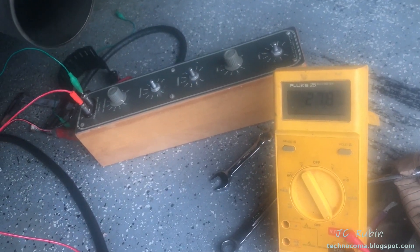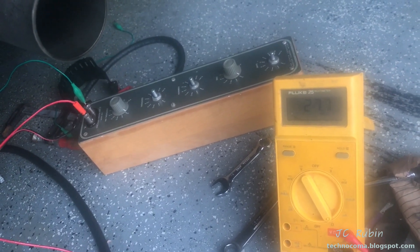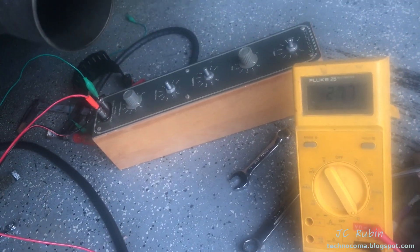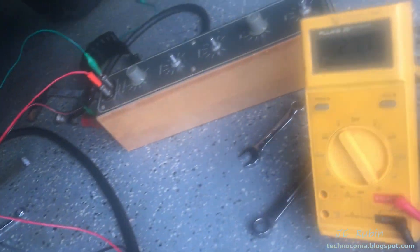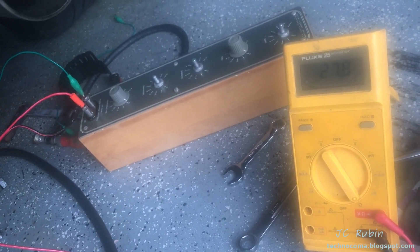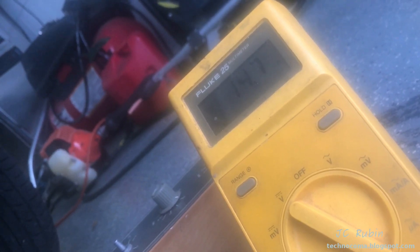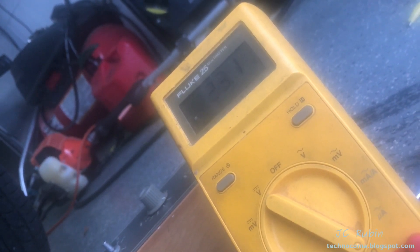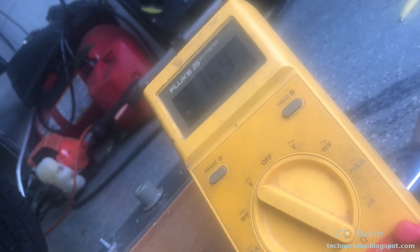Off the bat it's worth noting — I'm seeing 27.8 ohms connected right up to the device. I'm going to check my grounds; one wire goes directly to the pot, the other's connected to the pipe by the muffler. Something strange is happening: with the connector sitting at 14 to 15 ohms, if I move it a little bit and let go it jumps to 23 to 46, and if I wiggle it again it drops back to 15 to 16.